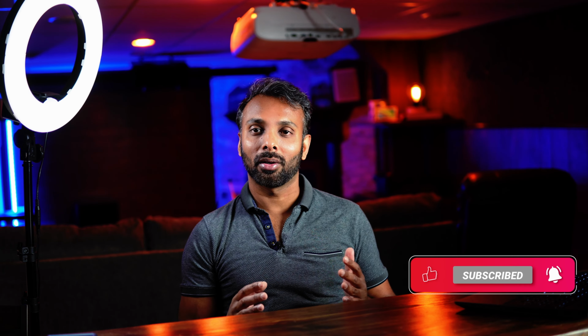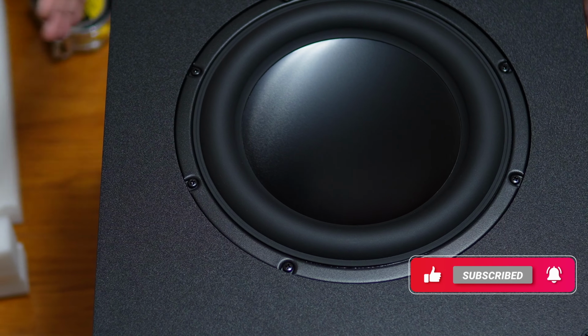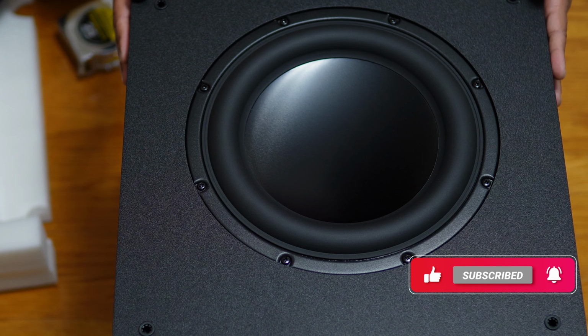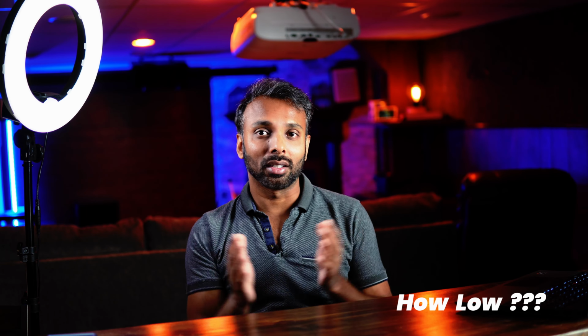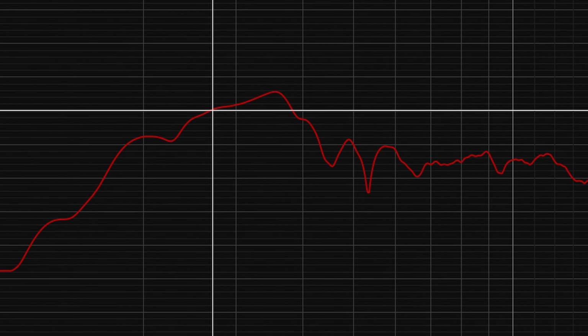Now, one of the main specifications that we all have been waiting for. RSL claims this goes from 27 Hz on the lower range to, I think the upper range is 200, but nobody cares about the upper range, right? When it comes to subwoofers, all we care about is how low this can go. So I tested this and I in fact got 27 Hz, and that is pretty decent with some room gain. I expected it to be lower than 26, but for some reason I only got around 27, but that is still pretty good.